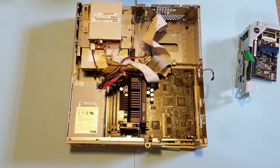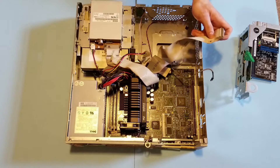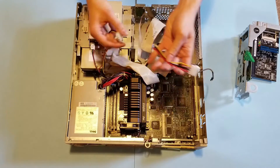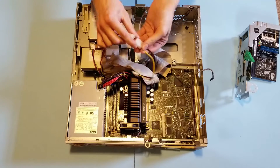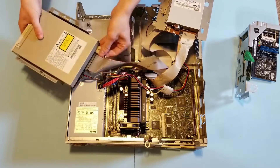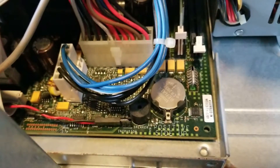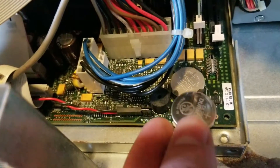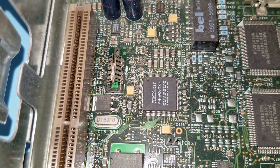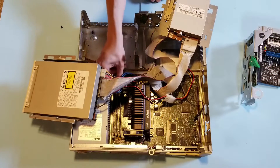That was easy. Now, we already have an IDE cable - the same as the original hard drive was using - but the adapter only accepts a 3.5 inch floppy drive power cable. As I don't have any spare ones, I'm going to use this Molex to floppy power converter cable that I got for $1.59. Both the floppy drive and the CD-ROM will have to come out so I can get to the battery. This is the battery - luckily it's not leaking, so I can easily replace it with one I bought at the local pharmacy. Another interesting thing is that this machine has an onboard sound chip by Crystal. I've heard good things about its DOS compatibility, but for now I'm going to stick with my Sound Blaster Live.